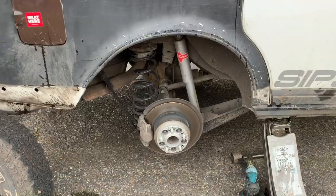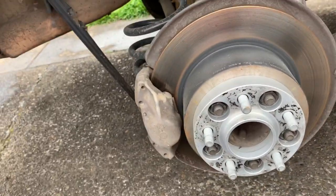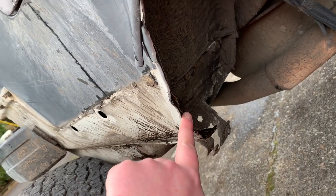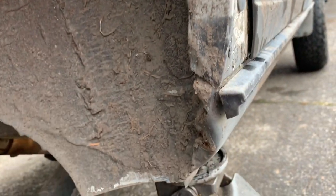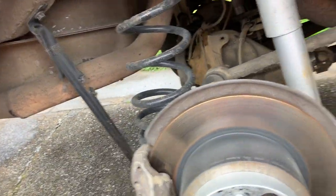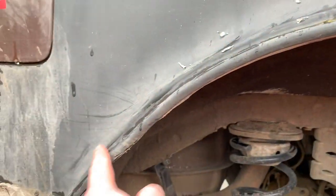Here's the rear of the car. I also put the 25mm H&R spacers on here just to get the track the same as the front, and that was kind of a mistake because it rubbed really bad. We had to cut out a bunch of this, and this is like three layers of pretty thick metal — it's pretty much a pain to get out. I actually tried to pull it further; you can see the marks there where I used some channel locks to try to pull it out. I'm going to need to actually cut most of this out, probably cut some more. Saw or angle grinder.